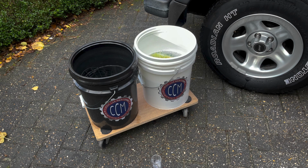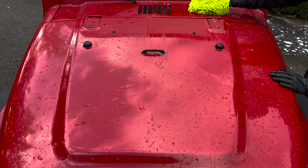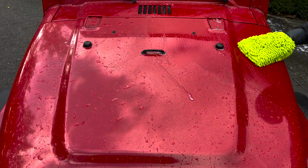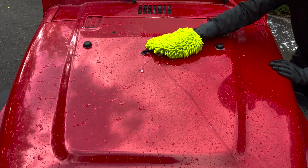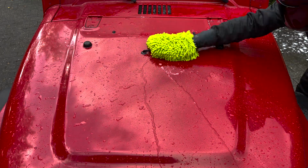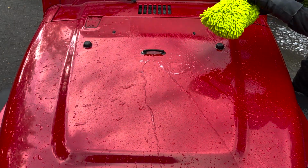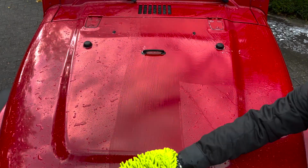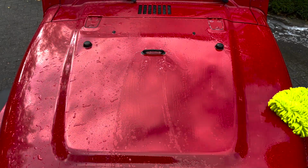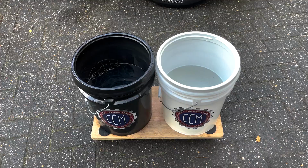The washboard in the rinsing bucket makes it easier to clean your wash mitt by rubbing it against the washboard. It's best to only apply light pressure and to swipe in straight lines in a crosshatch pattern. This greatly reduces the risk of visible swirl marks. You want to work in manageable, overlapping sections roughly the size of a quarter of your car's hood. Flip your mitt to a fresh, clean side for each new section. When both sides have been used, rinse it thoroughly. After you've wrung your wash mitt out, replenish it with soapy water.